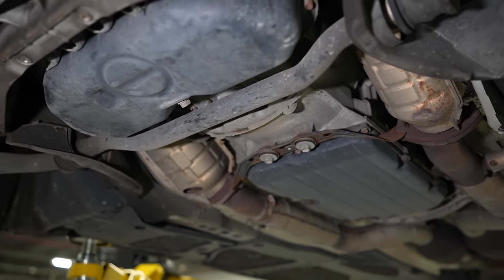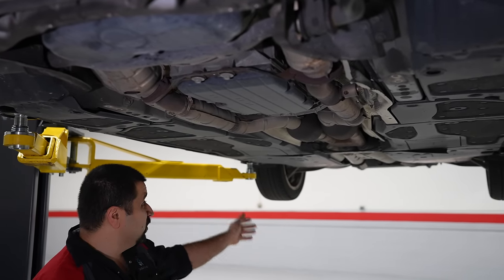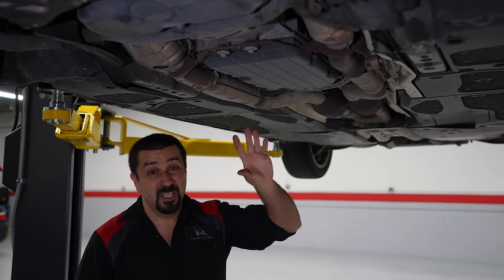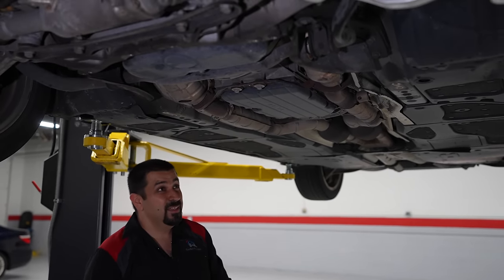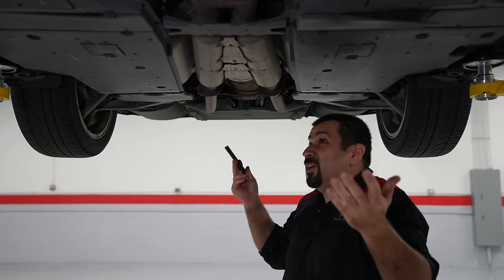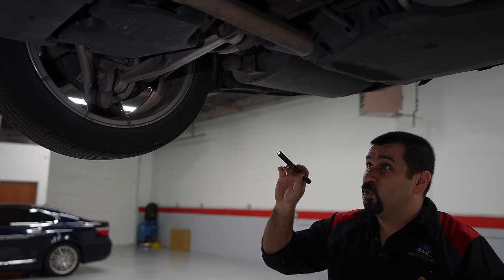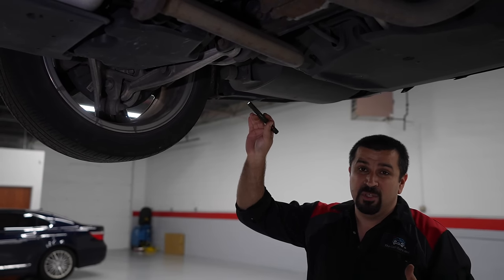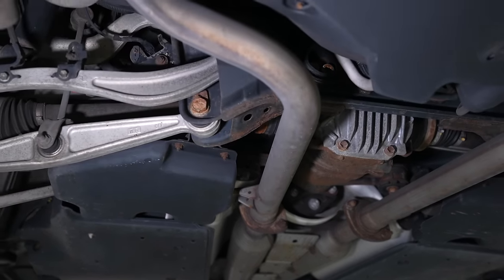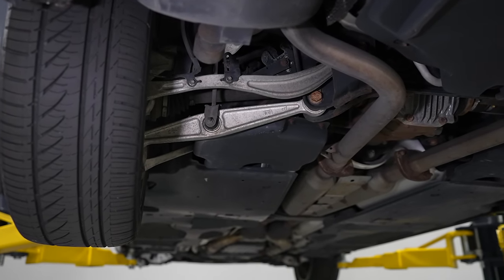The Japanese have something to learn from the Germans, which has to do with rust. Everything in the car is covered so you're not going to have rust, but the exhaust just rots away. Mufflers are already gone in this. The car is a little louder than usual. If you end up with one that has exhaust leaks because of rust, things will get extremely expensive. But otherwise this car is actually in great shape when you look past the front. The rear suspension looks fine - they don't really have issues with the rear suspension other than the air shock, which we are already replacing.